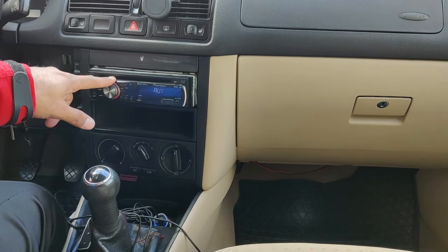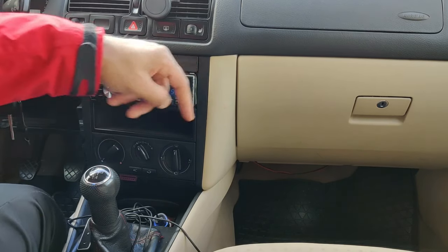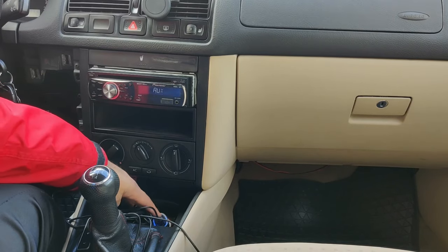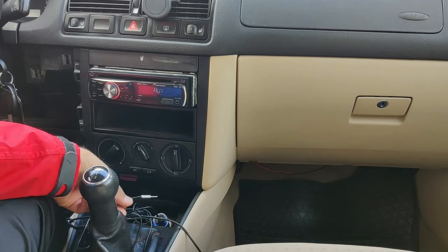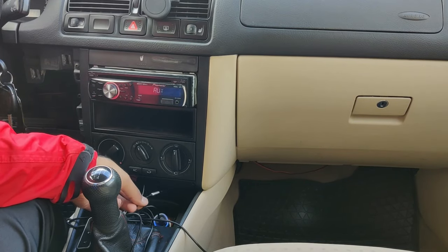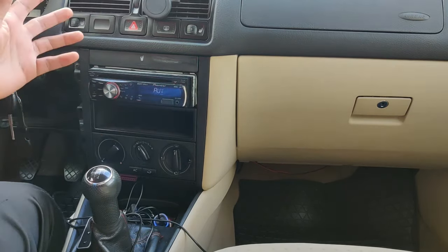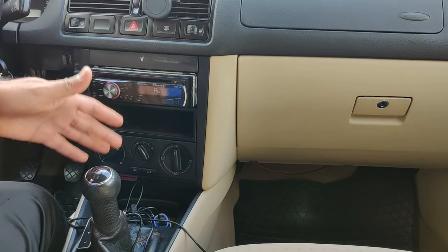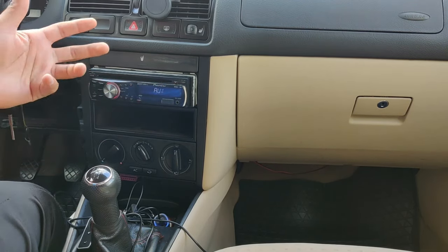These methods can work with any car. If you don't have an aux input on your stereo, you may have an aux location somewhere in your car — like the glove box. That makes the setup cleaner: run the power, connect your device, and route the aux wire to that location. This comes with some Ford Focus models and other cars.